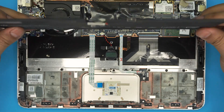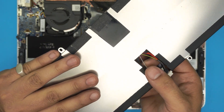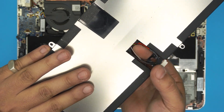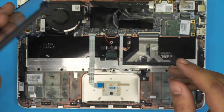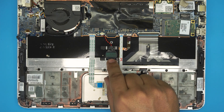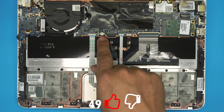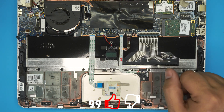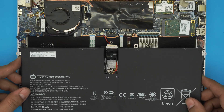And there is your humongous battery. When you grab the new battery, make sure the positive red wires are separated. Also, this small component is your BIOS battery — if your BIOS is not holding any charge or you want to reset the BIOS, just disconnect this jack and pull the cable back. That's it.